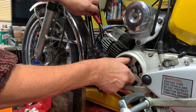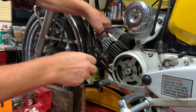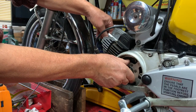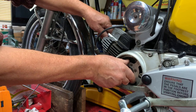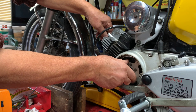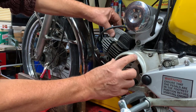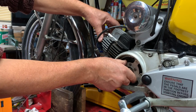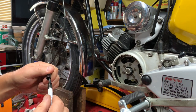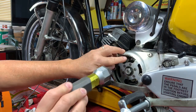Screw this stop in until it stops. Then I'm going to unscrew the stop until the piston will move - there we go. Back up a little bit and move that in so it's stopped. I'm making sure that the gap between the two marks isn't too big. That's nearly at top dead center. I'll use a little Sharpie - some might argue it's a bit thick but I'm pretty sure it's fine.